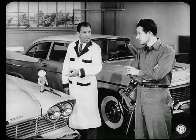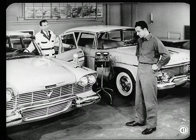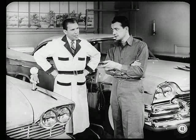Let's see if we can find out what's wrong with this car. Do we crank the engine with the lights on? Yep, good place to start. It's not cranking as fast as the first two cars, but the lights aren't dimming too much — might even be normal. Slow cranking and failure to start is the problem.